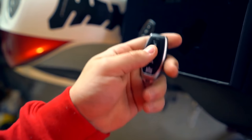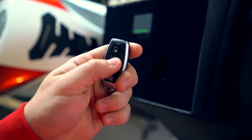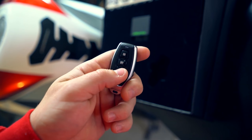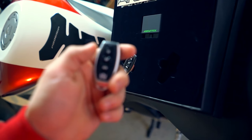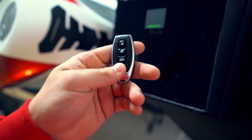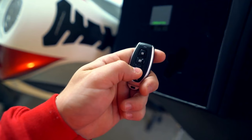The way this works is that if you want your exhaust open, hit on; if you want your exhaust closed, you hit off. It opens and closes these valves that make it quieter and louder. Then you can have it on auto, which opens up at a certain RPM — you can either set the RPM or it'll just open up at whatever RPM it's set at.